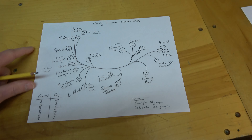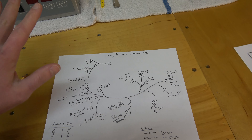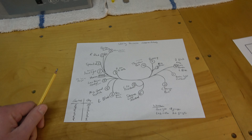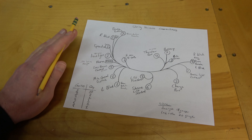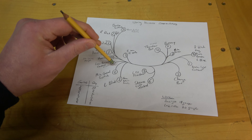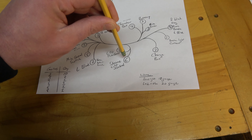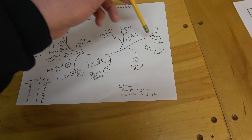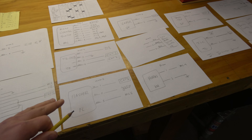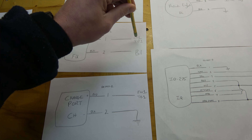The wiring harness is going to look like a part of the bike - one loom with a bunch of connectors coming off it, with all the connections made internally to the loom. This is pretty standard in the automotive industry and it's going to make the bike much easier to work on. For each connection I've listed how many cavities I need: the main control switch needs eight, the LED flasher needs three, the Scene lighting controller needs six, the Thunderbox needs four, and to the rear of the bike needs five.